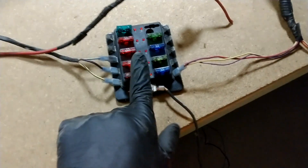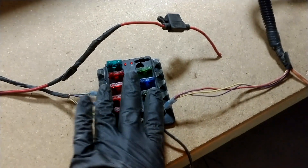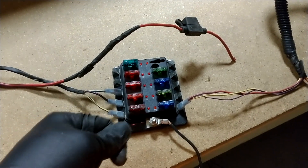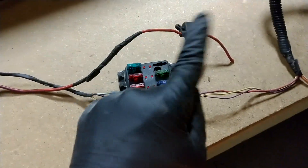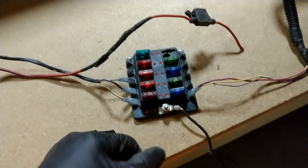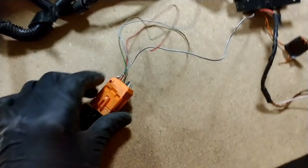So, real simple for power. My setup: turn the switch on, powers the bus, sends the battery constant, sends the wake-up signal to the ECM — the ECM is now on and awake. As soon as I turn the key on the Toyota side, because that side has the starter wire on the body harness, as soon as that starter wire fires, the engine starts to rotate. The ECU is awake, realizes it's rotating, and fires up instantly.